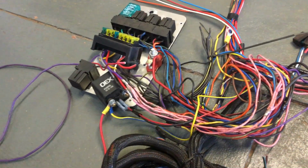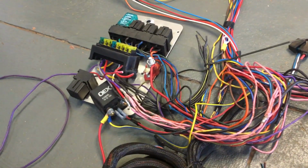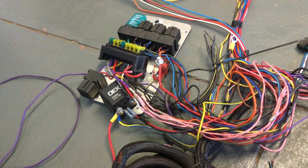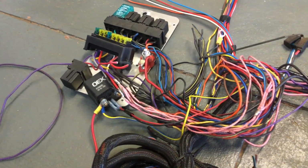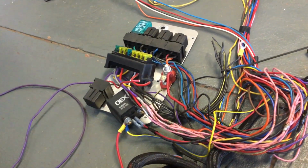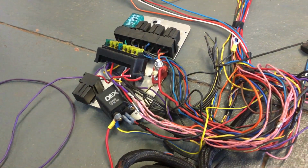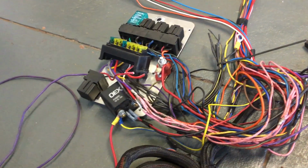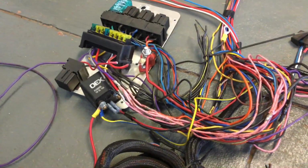And then the following, I didn't get another run. I changed spark plugs and put a couple back that I had taken with me that were spare, thinking I might have had dud spark plugs. But the spark plugs weren't duds, there was EMI interference in the loom, which is the next problem.